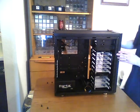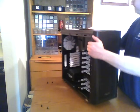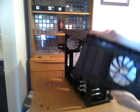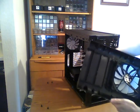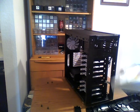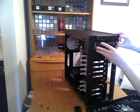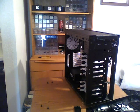I've got to put the optical drive in here. That means I need to remove one of these front knockouts. So that just pops out — there are two little tabs on either side, just release the tabs and this piece will come right out the front. The optical drive is going to go in here. Be careful — there's a little bit of wiring right up at the corner coming from the top control panel. Make sure that's out of the way, gently push it so you don't crimp the wires, then insert the drive. It's going to need some screws on either side to hold it in place.